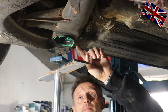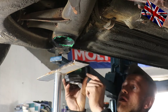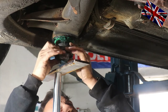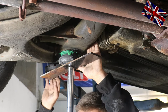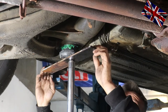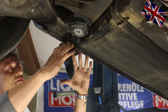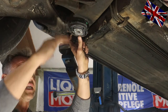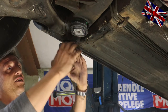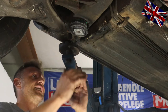As mentioned before, notches and indentations have to match. Do not forget — I told you twice. Do not put the blame on me in case you screw it up. Use some lubricant to make this easy on you. The rubber mount is greased in place and ready. We use a pole jack to press it further into the sleeve to its final position — the cross member will move up as well, just don't be surprised. If the car is standing on its tires and you cannot slide it in entirely, lower the car until the tires touch the ground and use a jack to press the mount up completely — it will fit snugly. To bolt the rubber mount, the cross member needs to be supported with a pole jack, otherwise the long bolt will not fit in.